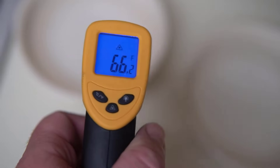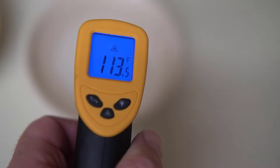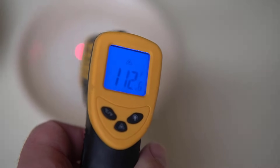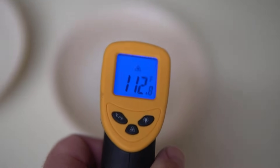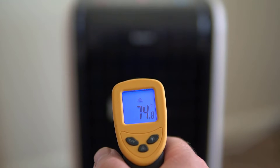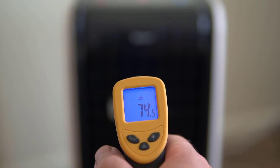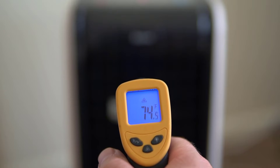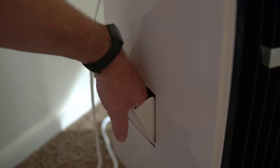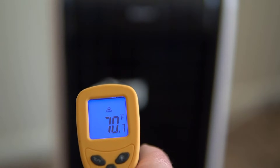For this experiment I used ice water and hot water to compare, so I got the water from the tap. You can see here that the cold water is 66 degrees while the hot water is 112 degrees. When I put in the cold water and used it in the evaporative cooler I was getting 74 degrees — so with 66 degree water the air coming out was 74 degrees. Then I put in a bunch of ice to make it as cold as possible and I was getting 70 degrees, so I was actually able to drop the temperature by about 4 degrees.